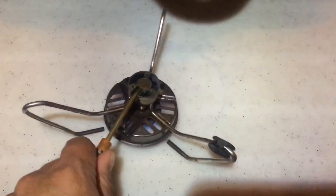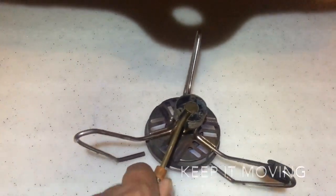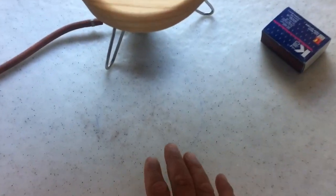Here we go then. We've heated that up — you can see there's some blackening here; oils are coming out of the plastics. I haven't run any sandpaper over that at all, so that's the plastic becoming rougher and better for the glue to stick to, so it's worth doing. Now the plastic's been heated and we've removed some of the oils, the next job is to take some really good quality heavy grain sandpaper and abrade this whole area really firmly to get a good seal with the glue.